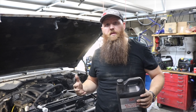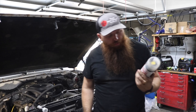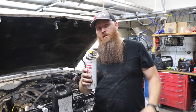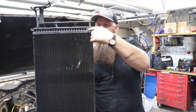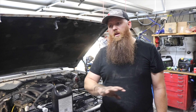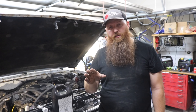The next step is to flush out the only component we haven't changed yet, which is the evaporator core — that's the part in the dash. We don't want to change it because it's in the dash. You can order flush in a can — it's already pressurized, you don't need an air compressor. You can flush out whatever components you need. Don't bother trying to flush out your condenser core, especially if you think there's metal in there. There are so many tiny little sections, and it is impossible to fully flush out a parallel-flow condenser core. Just replace it — save yourself time and potentially extend the life of your compressor, because metal shavings making it back to your compressor will start chewing it up.